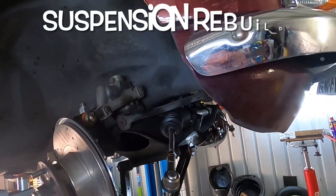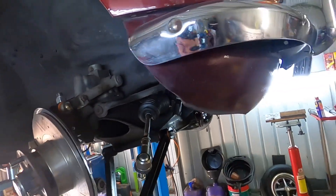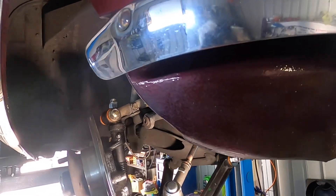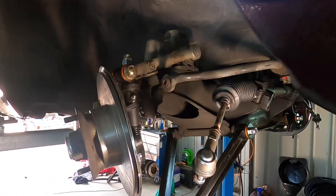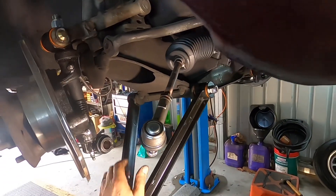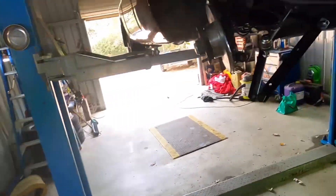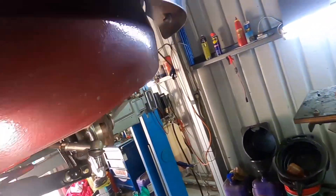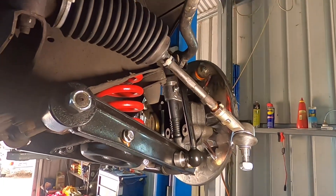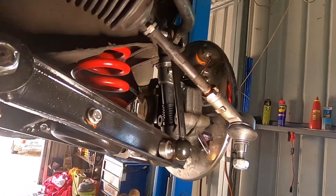Carrying on now — this is the second bit, talking about the rebuilding of the front suspension and what I've done on the rear. As you can see, the king pins are in. I've put the arms on but haven't rebuilt this side just yet as I've got a bit more work to do — I need to grease that and fit it. This side has been built up apart from the steering arm. Nylock nuts, everything's been painted, and I haven't tightened anything up yet.